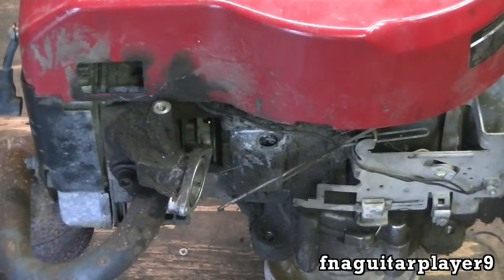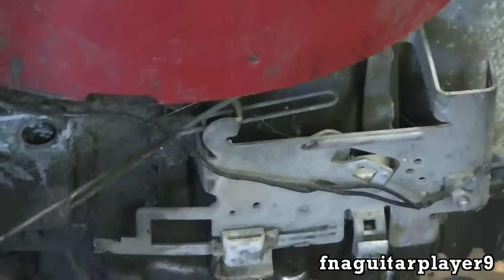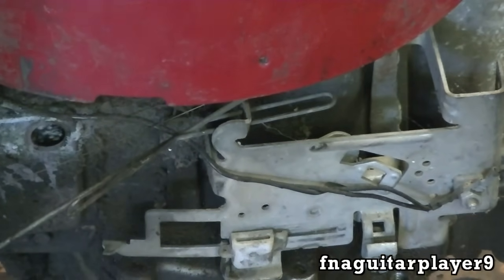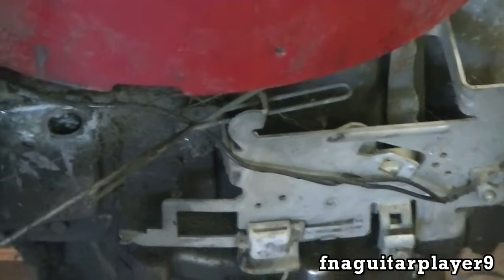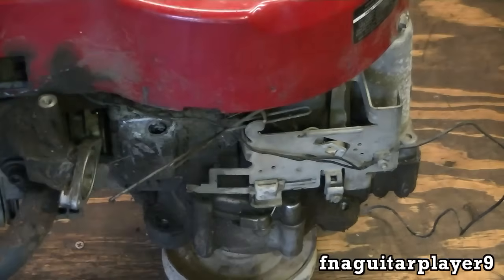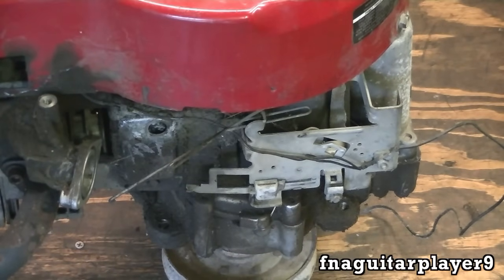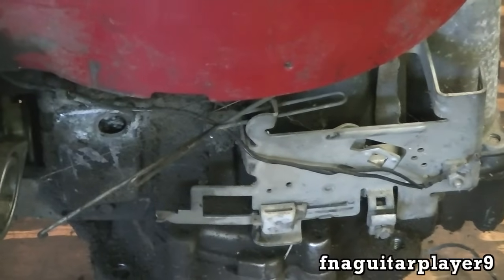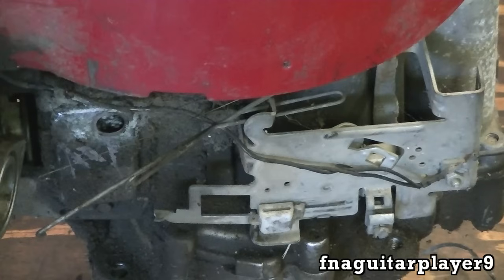I'll put it back as soon as I'm done testing. I probably won't put the air filter assembly on yet — I'll just put the carburetor on and hook the linkages up just to test everything. This has a setup I don't like: it's an automatic choke — when you give it full throttle it kicks the choke in. I don't like it because you don't want a cold engine revving up all the way; you can score a bearing very easily. What I usually do is do away with that. There's already a dent right there — you drill that out, put a clamp in, and hook up your regular choke cable. I like to be in charge of the choke. It's not good to rev an engine when it's cold. For right now I'll just hook it up like it is with the automatic choke, but I'll choke it manually when I start it.